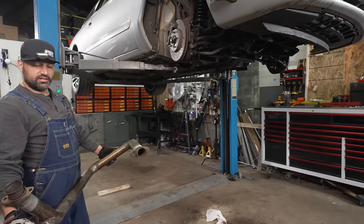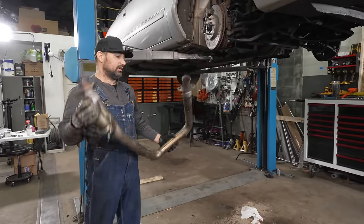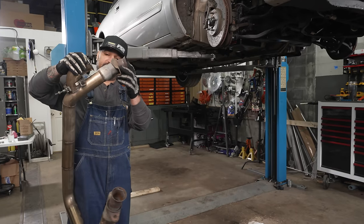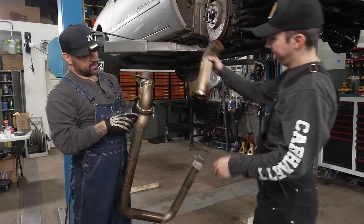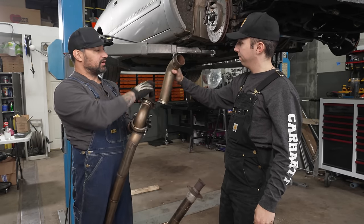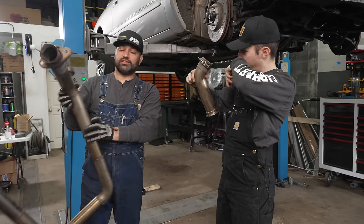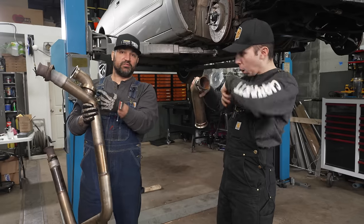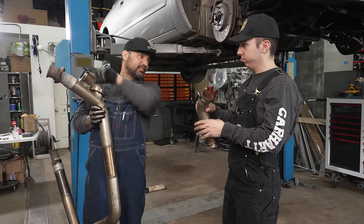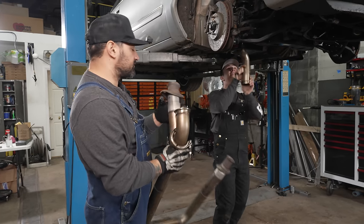Get that sucker. So this is what we built before. It just basically connects the two factory exhaust manifold outlets into a big U-pipe, and then we just pipe right off of it to pick up the turbocharger. So exhaust pulses slam into each other here. They argue about where to go here. And they say, oh, let's go out this way. And then they're like, bam, turbine wheel. They spin that thing and we make turbo boost.